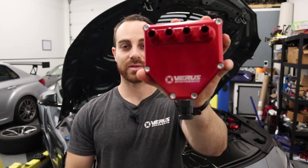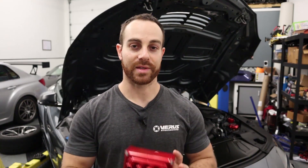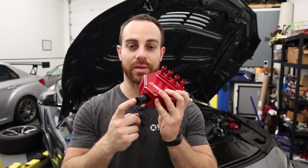What's up guys, and welcome back to another Supra install for our 2020 GR Toyota Supra. We're basically going to be installing an air oil separator today. An air oil separator separates out the oil and water in the crankcase from going back into the intake and back into the engine, which can clog valves and reduce power and octane rating. By installing one of these, it traps the oil and allows you to drain it out the bottom, keeping it away from the intake.